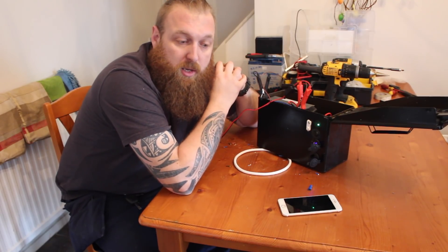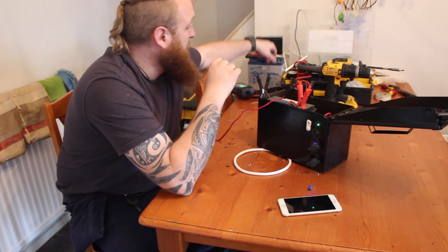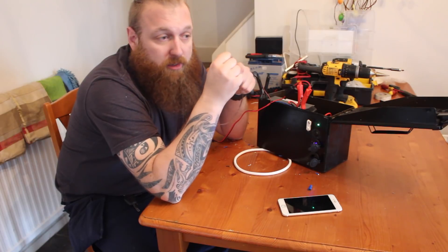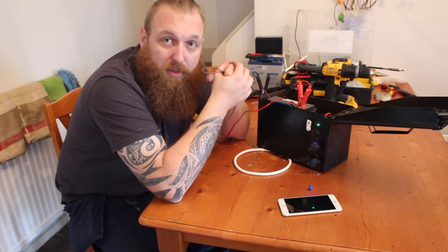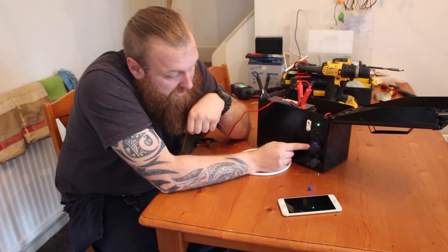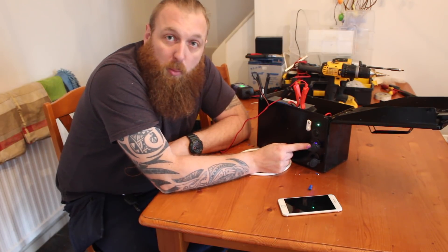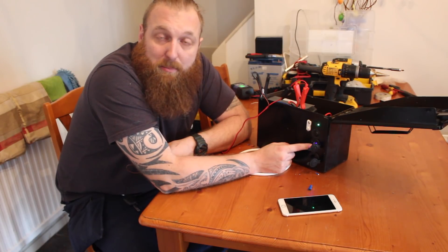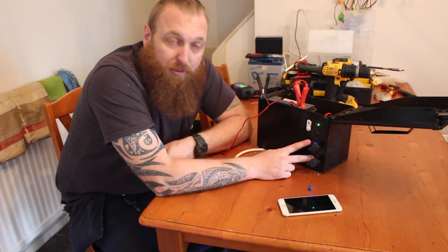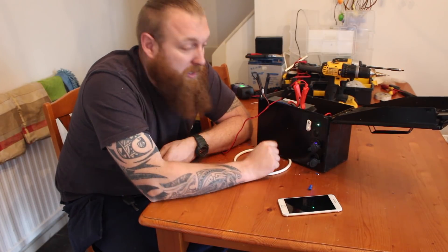Make sure your connections are good, make sure your fuses are the right size, and your cables the right diameter. A good rule of thumb - I'll always go a little bit over on the cable; you may lose a little bit of amperage doing it that way, but I'd rather be safe than sorry. For fuses, I'd rather go a little bit smaller so I'd rather blow a fuse every now and again if I was abusing it. You can look on the amperage of here - 2.1 amp on one of the 5 volt chargers, 1 amp there - so that's 3.1 amp total, you could put a 3.5 amp fuse in there.